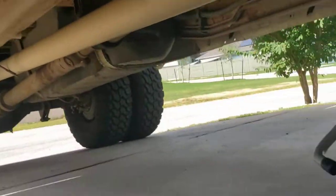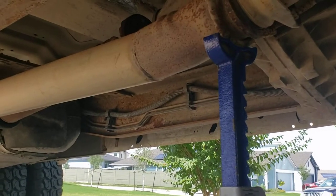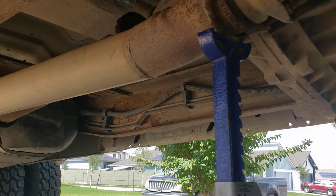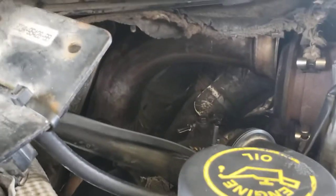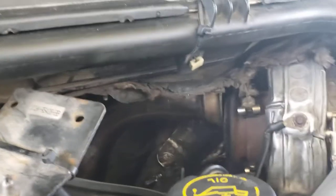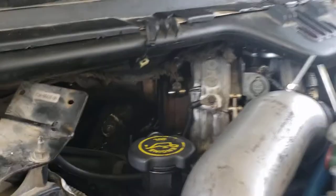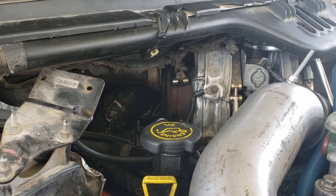All I did — I didn't have a jack, it's in storage — I took a jack stand, pushed my exhaust up in the air, pulled the jack stand up, and stuck it right there. It gave me enough space to thread the band clamp bolt through there, put the screw on manually, and then tighten it down. Hope this helps somebody and you don't go crazy like I was about to. Keep on going.